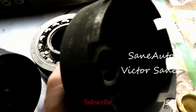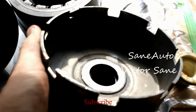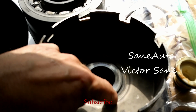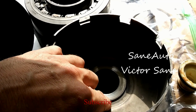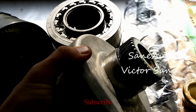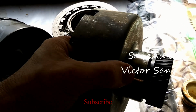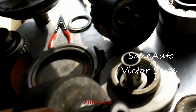Then you're going to have your sun gear and sun shell, which you need to carefully look right here where this weld is, because it'll crack at the weld and it'll be a tiny crack that you can't see. Sometimes this sun shell will be able to spin on the sun gear and you won't even notice it unless you grab it and really try to move it. But the car can spin it very easily.